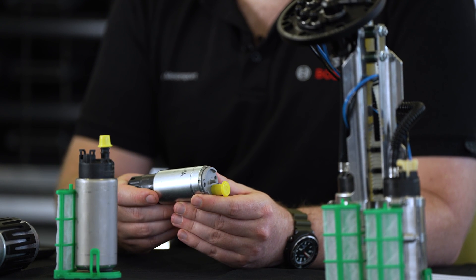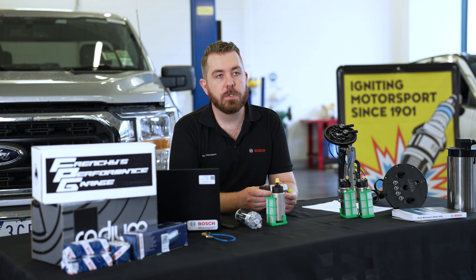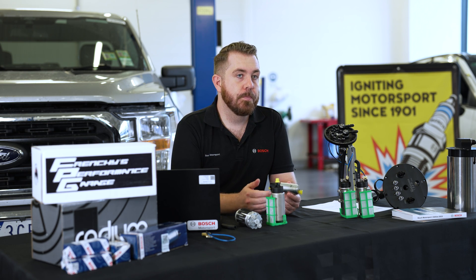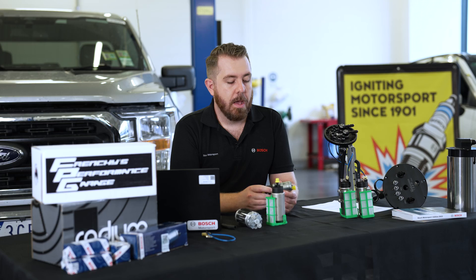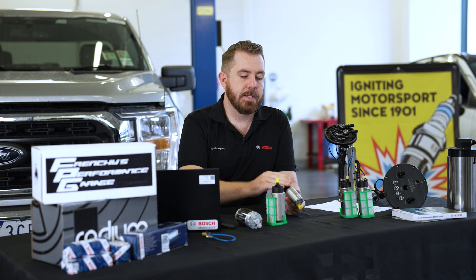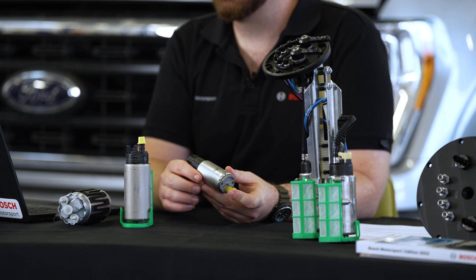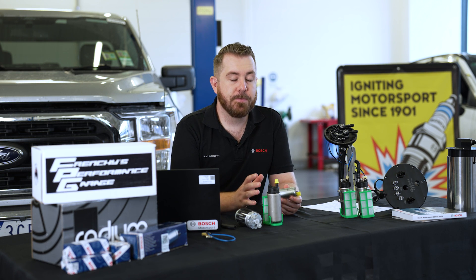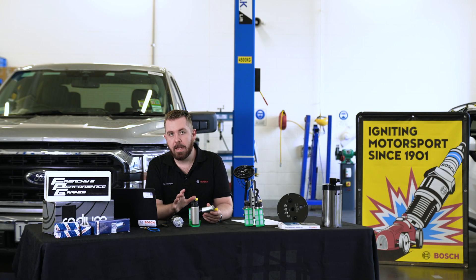The second thing to be aware of with an E85 fuel pump is fuel volume flow. E85 has less energy content than the corresponding amount of gasoline, so as a result you need to flow more fuel. We've seen that this is somewhere in the range of 30 to 40% more fuel, and the effect is that you may need to step up a size in fuel pump to make sure you can support your power goals when running E85. This video doesn't cover diesel or methanol fuels — those are very different considerations — and today we're just focusing on ethanol based fuels and gasoline.